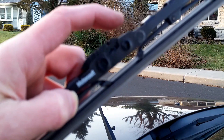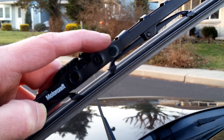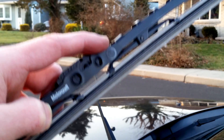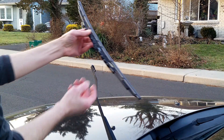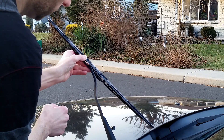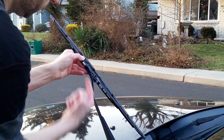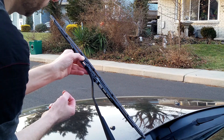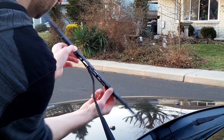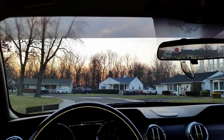Now we've got the new wiper blade fresh out of the box. See my finger right there — that's the wiper blade indicator. Eventually that'll all turn yellow, but right now it's brand new, black, good to go. We're gonna put it on — you want to have it parallel with the setup like this. There is a little hole there that's going to go through the J-hook. Go down a little bit, have it as close as possible. There are going to be two little tabs on the side — when you push up on it you hear a little click and you know you're good. Just go up — snap into place, now you're good to go.